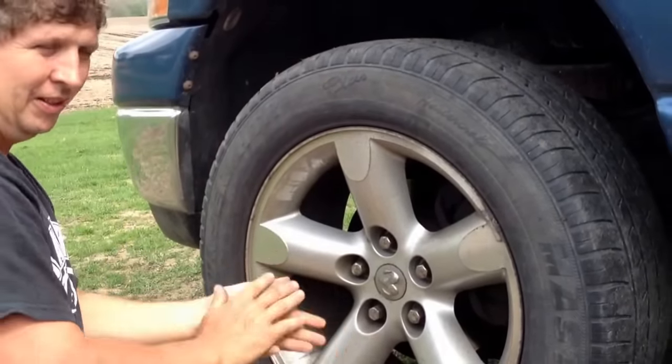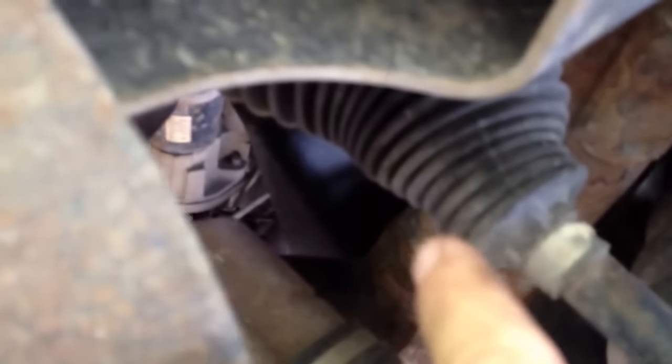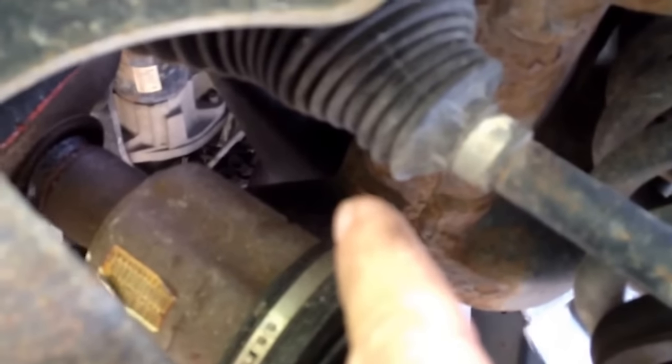The worst one on this is the upper one. I'll point out which ones are which — your upper ball joints are these here, your lower ball joints are right up in here, this is your outer tie rod end, and up through here is your inner tie rod. The problem with this one is a bad lower ball joint and an upper ball joint.